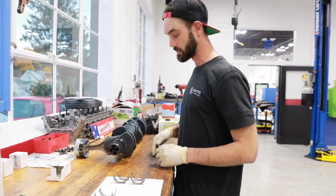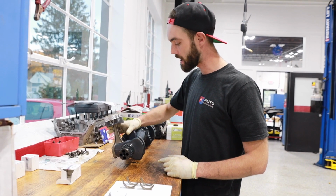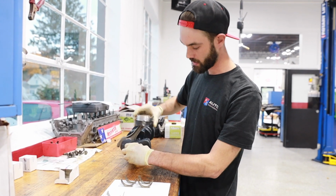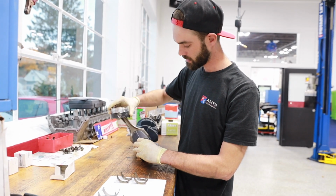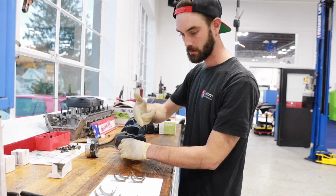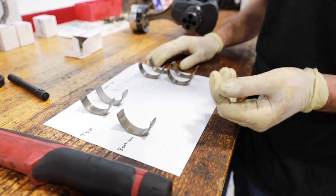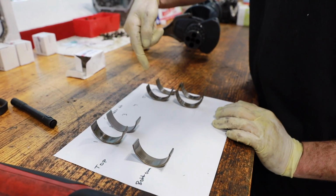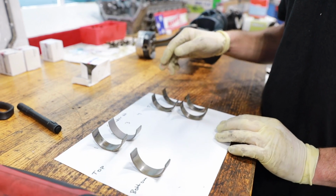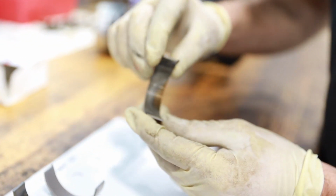Got it. So with it spinning that fast, obviously you have the need for a bearing, because this is spinning at 8,000 RPMs, more or less. So what's going on in there? This is what we got going on in there. Now we've already pulled out a couple of bearings. We've pulled out number 5, number 6, and number 1. Now you can tell we've already got some pretty heavy wear here.